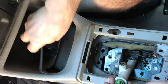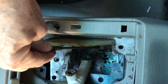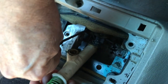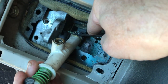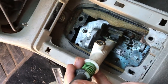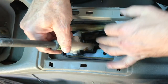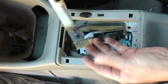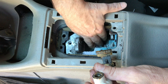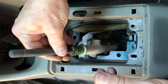It's all right here, so you don't have to get this out. But if you've also bought the cable end bushings, the only way to service that bushing is right here. The shift cable is held on with a little Mickey Mouse cotter pin looking thing. Just push the head of the pin and it comes out — use a pick or a magnet to extract the Mickey Mouse pin. Once you've done that, the shift cable comes off and you can service this bushing. The side-to-side bushing is a little further down on this side and will be really difficult to service without dropping the box. That's it for the shifter.